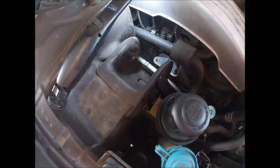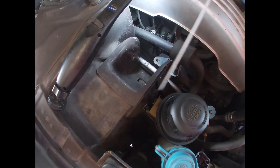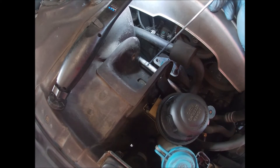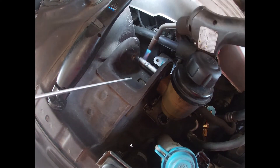I'm going to heat this line up with just a map gas or propane torch. I'm going to use a Blue Demon brazing rod — there's a tiny pinhole there — and I'm just going to try to run some brazing rod here, try to build this up a little bit, try to repair the line instead of replacing it. This is something you can do on a lot of AC jobs. I don't know why more people don't do it. I'll show you how to do it.